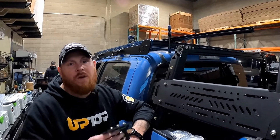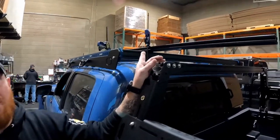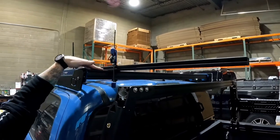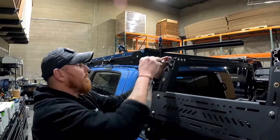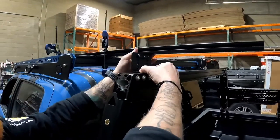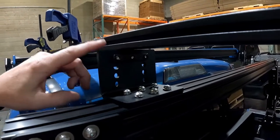The install we're working on today is on a Toyota Tacoma. We're going to use the ETM to get the load bars of the EX as close to level with the roof rack as we can. We've taken a load bar that came with the EX kit and clamped it to the top of the load bar on the roof rack. I'm going to slide the ETM in to the top of the load bar on the truss and slide this over. That's my fitment for a Toyota Tacoma on a 19-inch leg.